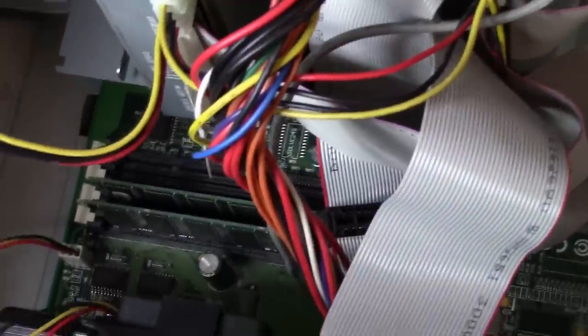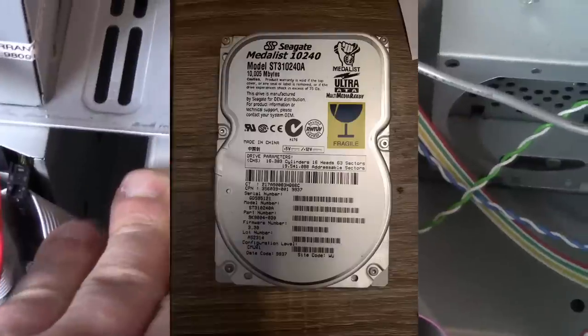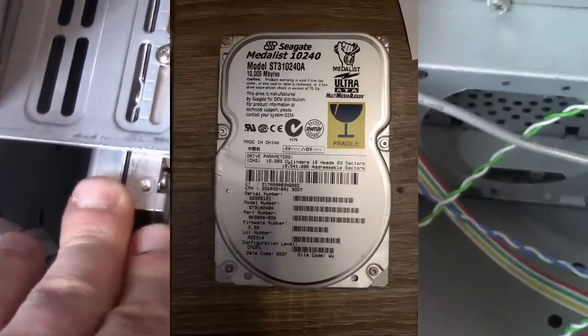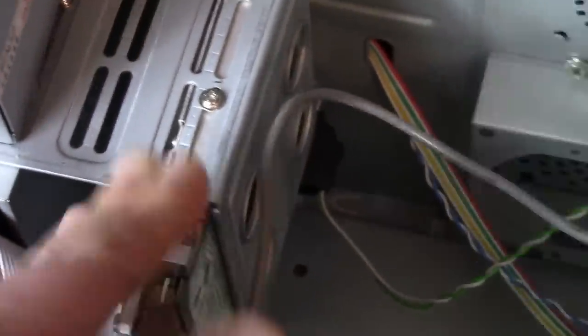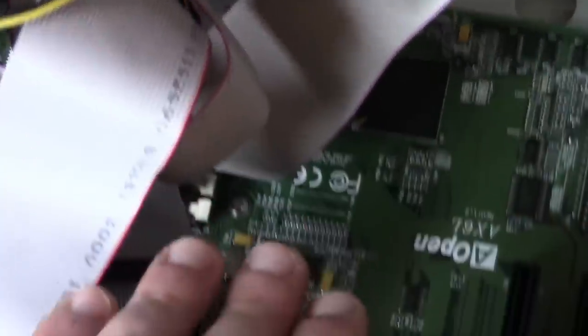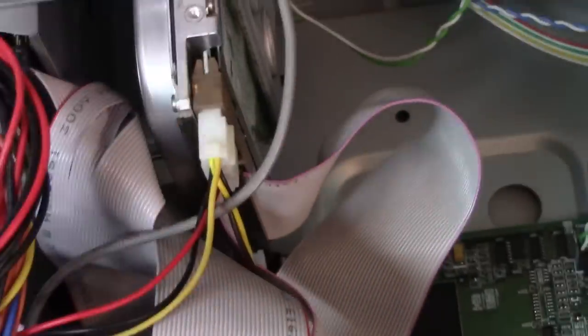The CPU is the same one from the original build. The hard drive is a Seagate Medalist at 10 GB, which is a little high for 1997 — on the high end we were probably looking at 4 or 6 GB. But it's running on the IDE on the motherboard, restricted to ATA 33 transfer speeds, so it'll effectively run like a 1997 drive — just a bit bigger than what was available at the time.